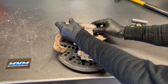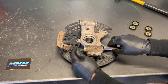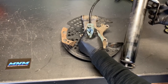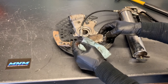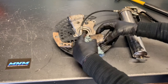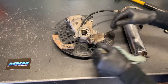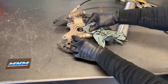Now take this inner part of the bushing and slide it in, then do the same thing on the other side. Before going back on the four-wheeler, I like to take my grease gun and get those full of grease — it's a little easier to do it now than once it's mounted. About three squirts — possibly four — will fill that area up. Wipe down any excess so you don't have dirt accumulating. When it's on the four-wheeler, the grease will squirt out and make a mess, so it's much easier to wipe it down off the machine. That took about three squirts, then same thing on the other side — three squirts again.